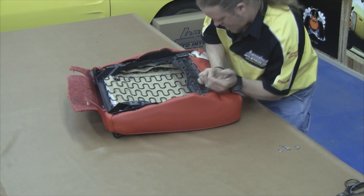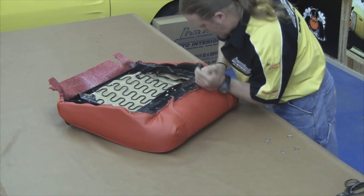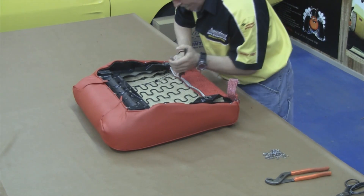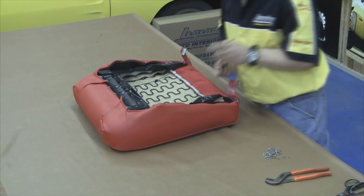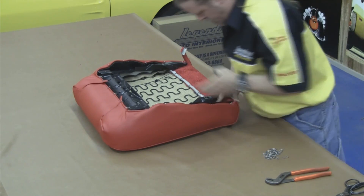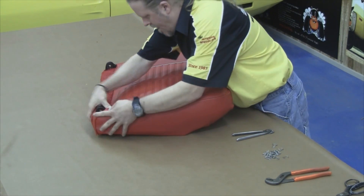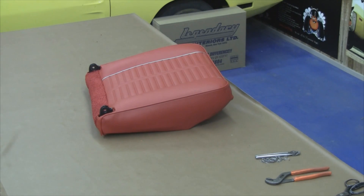After your front edge is attached, the corner flaps that fold inward on the front seat bottom kind of interlock. You want to pull those tight so it doesn't leave a gap and show your molded foam kit right through your seat cover. Our last step in our front seat bottom seat cover installation will be to install the rear carpeted section, which we call the rear stretch panel. We want to fold that over to the bottom edge and hog-ring through the listing cord and around the seat springs. There are two tabs on the very outside edges — tuck them in between the seat frame and anchor each with one hog ring. This should finish your seat cover installation on your front seat bottom, making sure the hinge areas look nice and your seat cover is wrinkle-free.